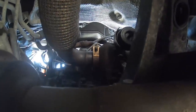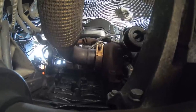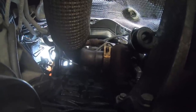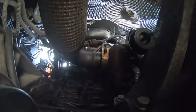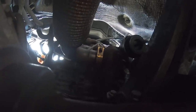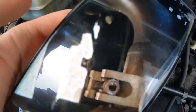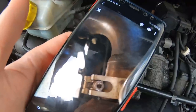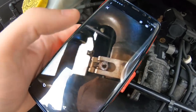I already have my van in the air. In the middle of the screen you can see the clamp for the downpipe and the hot side of the turbo. That clamp looks like it undoes from the top. I was struggling to see what bolt it was, so I used my phone to take a picture - and that is actually an allen key bolt. We just need the right fitting, probably five or six mil, undo it, and the pipe will move out of the way.